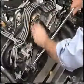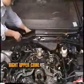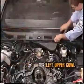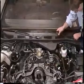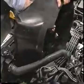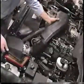Now install the accessory drive belt. Install the wiper module assembly. Install the right upper cowl and the left upper cowl onto the vehicle. Install the weatherstrip seal and the wiper arms. Connect the fuel lines. Now install the cooling fan and shroud. Install the air inlet tube.